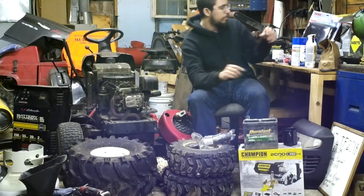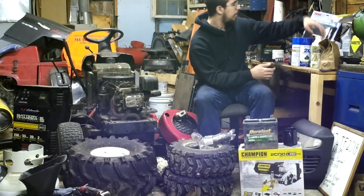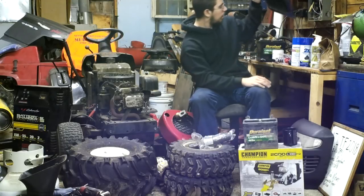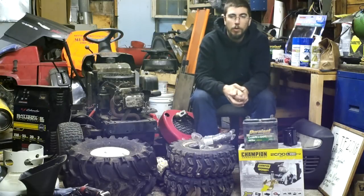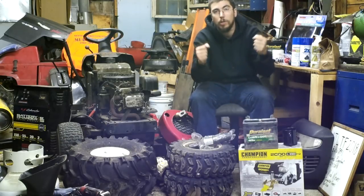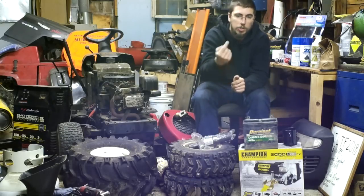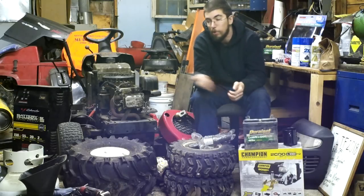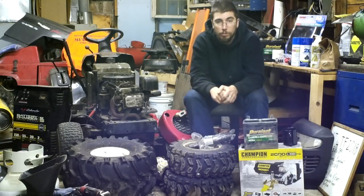The top of the hood will probably be a white color, and I'm going to install this air scoop and make it a functional air scoop — that's one of my biggest pet peeves in the off-road mower community when a hood scoop is just cosmetic. I intend to set up a snorkel system that actually comes up into the scoop so we're not blowing out head gaskets by submerging the motor under water or bending rods.